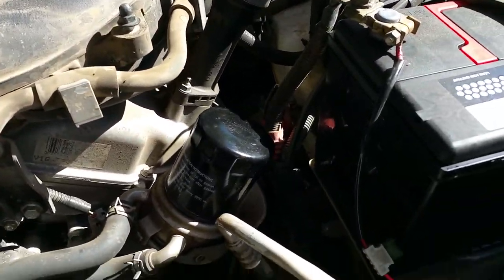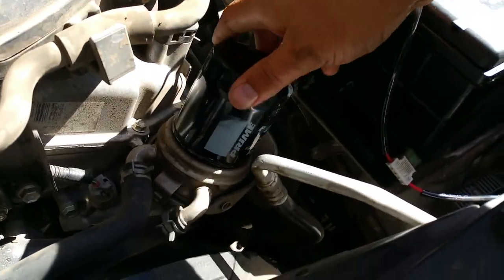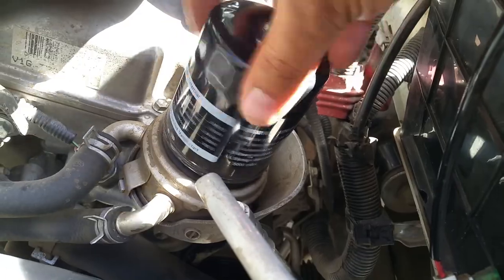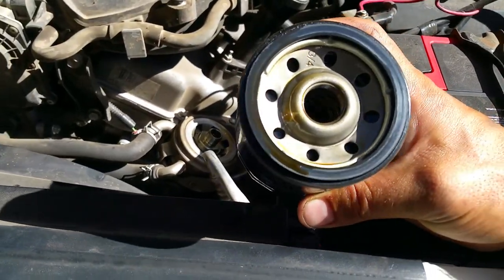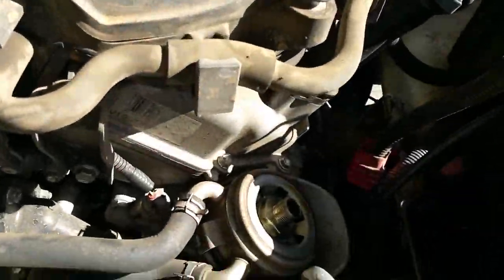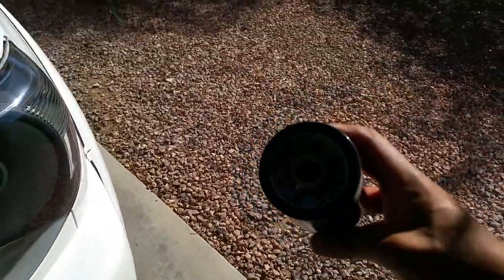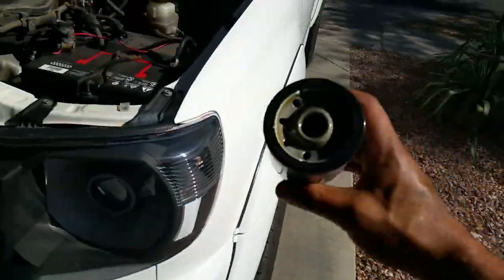The previous technician put the filter on a little tight, so I had to use tools to get it off. Once loose, we can watch the oil start to run into that little relief valve — but nothing came out. This tells me it was entirely the wrong filter for this engine, because it doesn't have an anti-drain-back valve. This has actually been harming my engine the entire time, because all the oil has been draining out when the engine shuts off and running back down to the pan — so there's been no oil pressure when the engine starts in the morning. Now I'm going to fix that with a proper oil filter and explain how synthetic oils work.